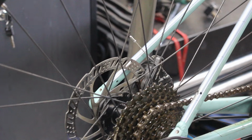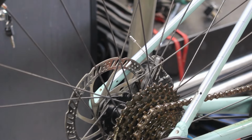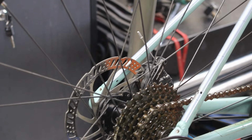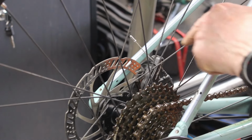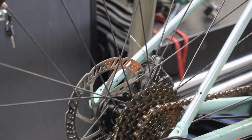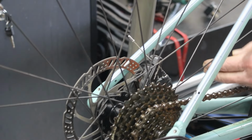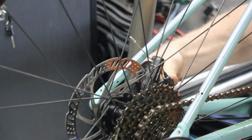So far so good, we're doing all right with these sinking the cameras. Right, so just checking this. So these aren't hydraulic, these are cable. So there's a ball bearing in there, and that pulls across, it pushes the ball bearing up that rubs on that. So it's obviously, they've worn a bit. So what we first need to do is just take the slack out. So we need to wangle this back a bit.